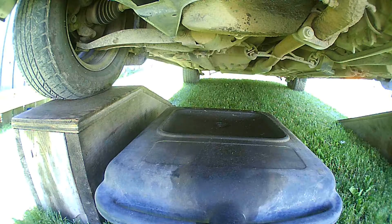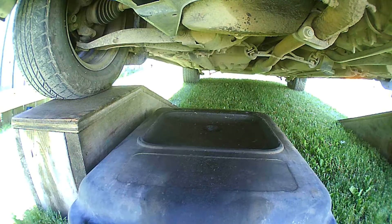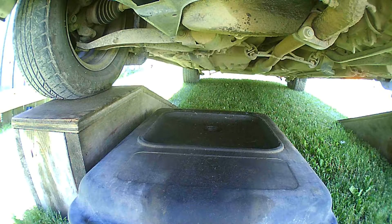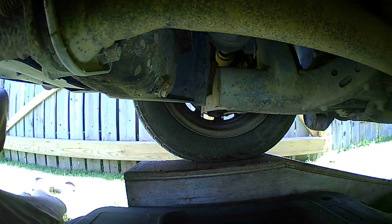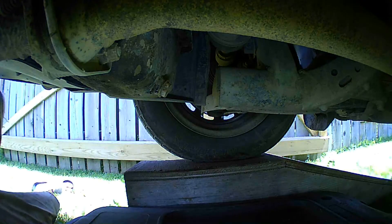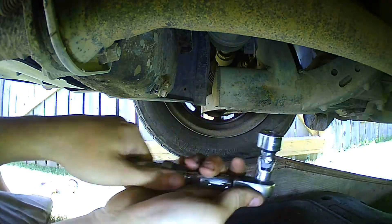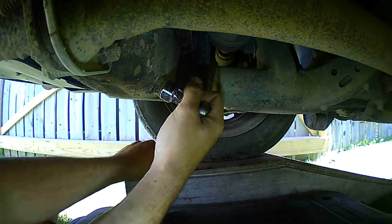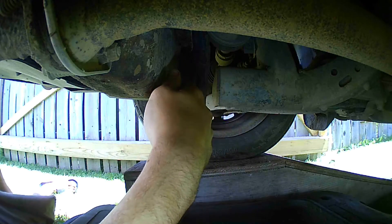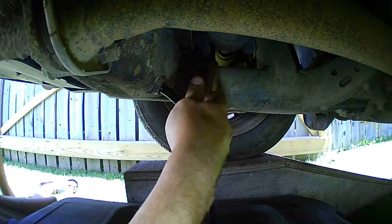I apologize about the wind noise. Now that we're under the car, first thing you want to do is get yourself a collection pan. I've got this big huge drain pan because when I change oil on trucks and vans and bigger vehicles, it quite often comes close to being full. You're also going to need either a socket and a ratchet or a wrench. In my case I'm going to use a socket — it's a three-quarter inch socket on the drain plug. I like to use this ratchet when I do oil changes because I can extend it to get more leverage on drain plugs that are pretty seized. This one's pretty easy. Then just pull this out and let it drain.